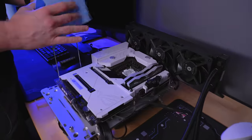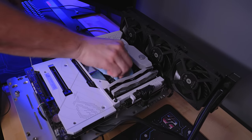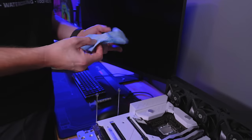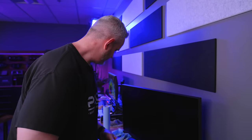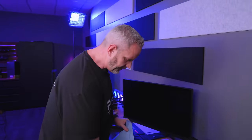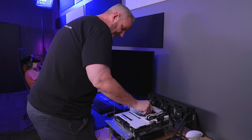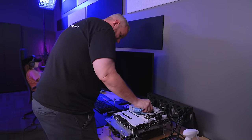Since it's water-based it should clean up well with isopropyl alcohol — and yeah, it just wipes right off. Looks like Elmer's glue. Unfortunately I had to take the CPU out because it got into the pins a bit, but I was able to clean that up with alcohol. Because it's water-based it just dries up and evaporates — so cleanup was manageable.